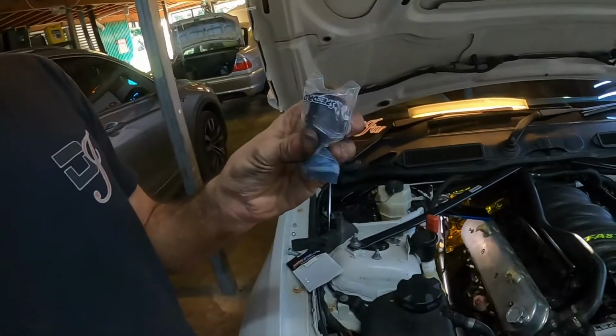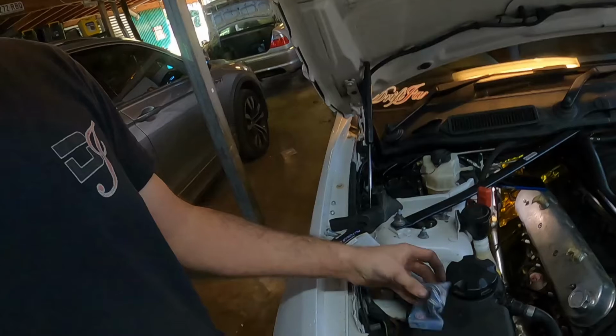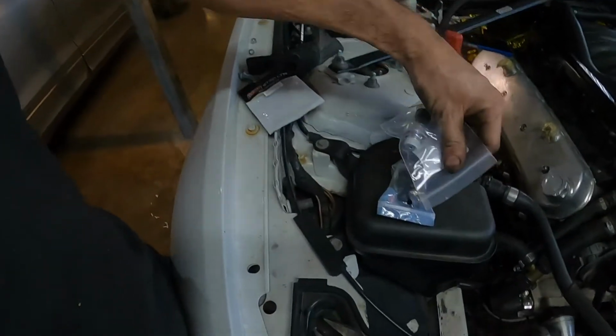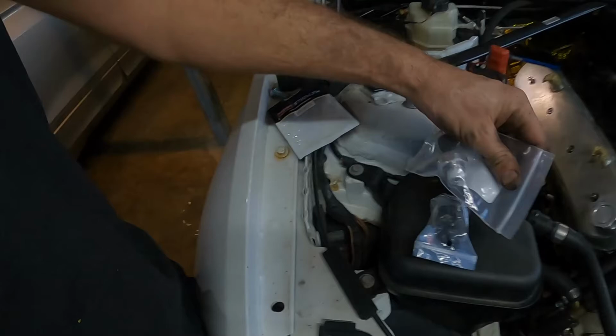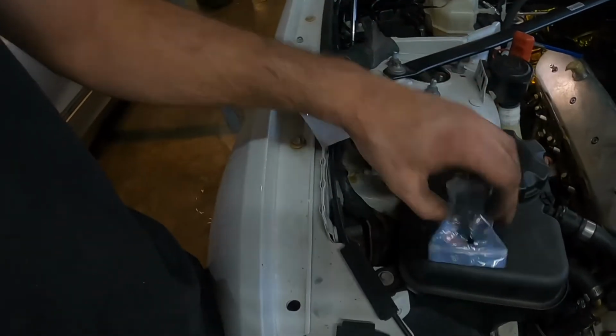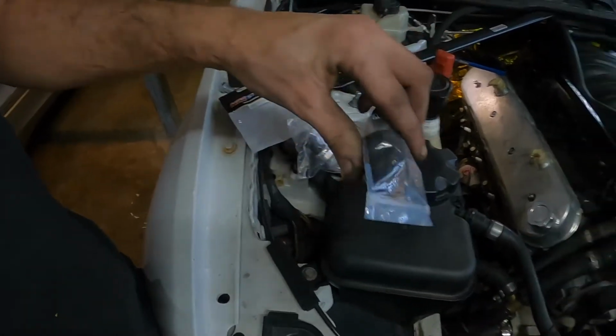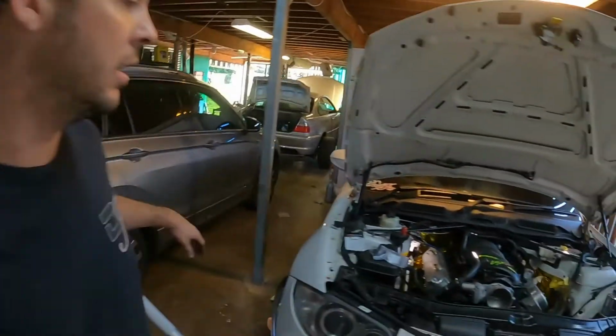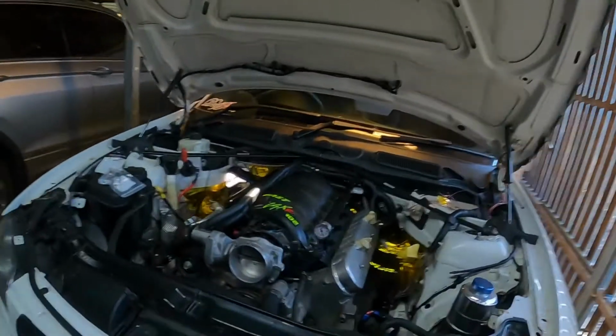Also, the normal oil fitting for the back. So the oil sensor goes in the top rather than into the block. And then you've got 1/8 NPTs on the side of it, so you can put an oil gauge on that, an aftermarket oil gauge, or an extra, or even a temperature if you really wanted to. But that's about it for the Beamer.